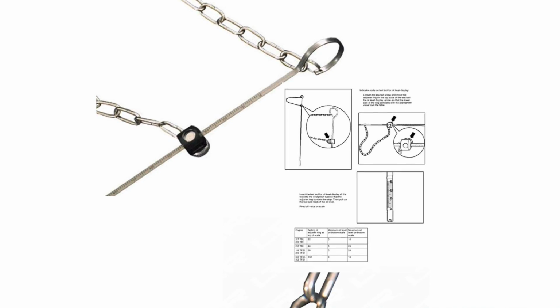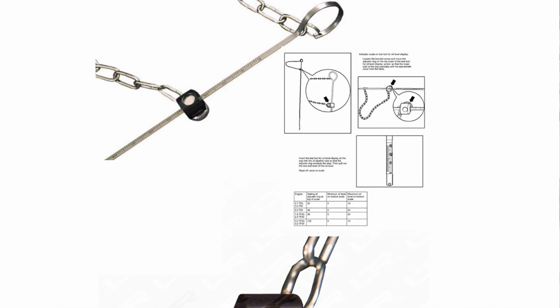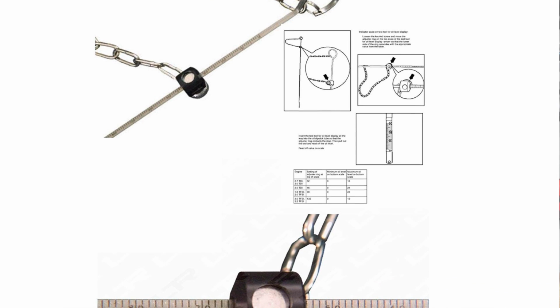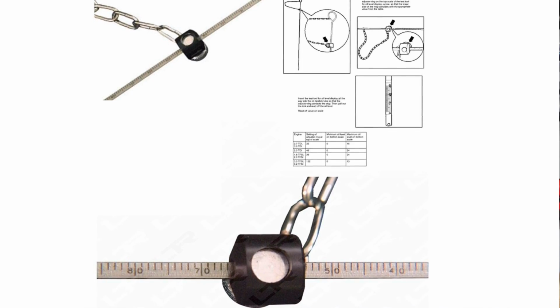So Craig's got, what did he say, a 14. Maybe that 2013 engine had the dipstick and it's the same length. Maybe it's a little longer or a little shorter and you can sort of calibrate it and throw an etched mark or a scratch on the dipstick so you know where the level is going to be. Or you can buy something like an adjustable one on Amazon. They're super cheap and you just set the adjustment to the right height, drop it in, pull it out, okay, it's good, and then you store it up on the shelf or something like that.